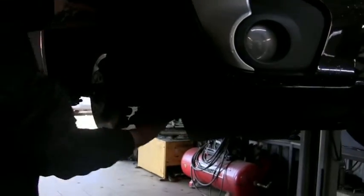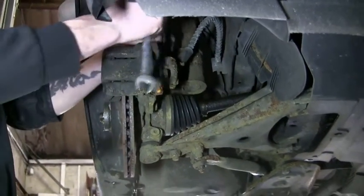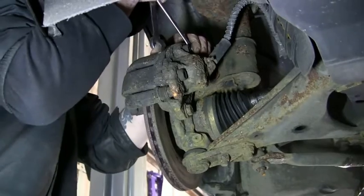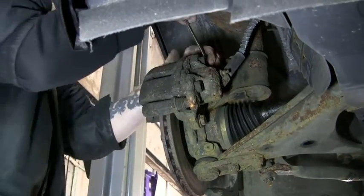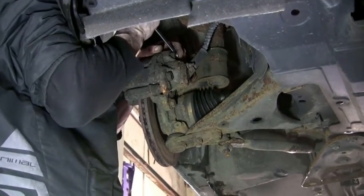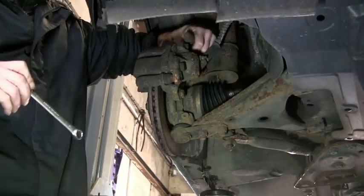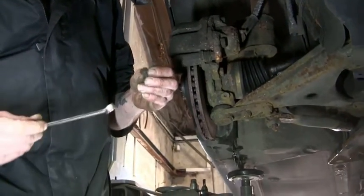Right, so first step, removing the caliper. I think that slider might be seized. Oh, that's moving. Okay, this is the first one removed. Again. Make sure you stay square on it, otherwise it will round up. Just going to tighten that one. Did she go or did she round? No, she went. There we go. Hopefully we'll get new bolts in with that, but that's not too bad.